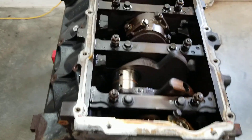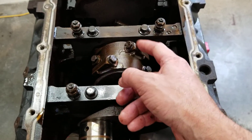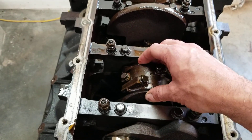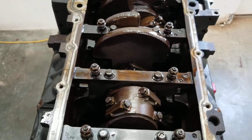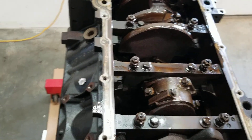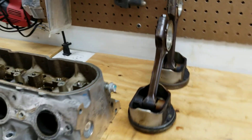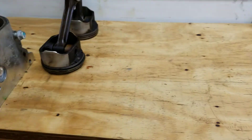What I like to do is label these. I'll hit them with brake cleaner first, wipe them off. The side that faces out when you've got that particular crank throw at bottom dead center for both pistons — that's when you want to loosen these so you can push the piston out. I'll label it with a Sharpie: this would be cylinder 4, so 4 and 4; this one would be 3, 3 and 3. Then I'll throw them on my bench in the same position the engine's facing on the stand, but right side up: 1, 2, 3, 5, 7, et cetera.